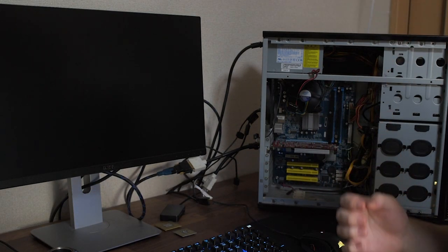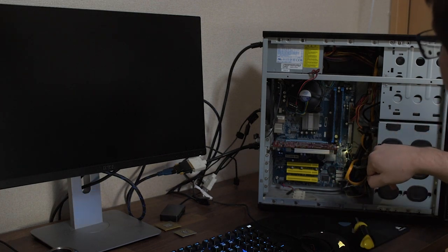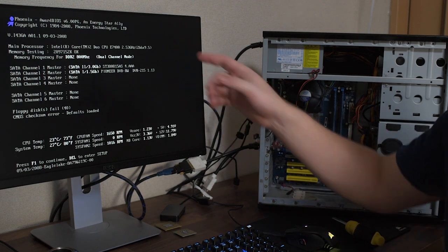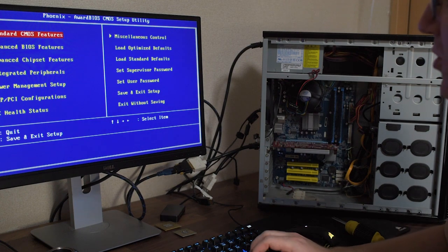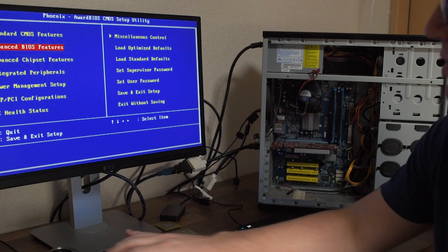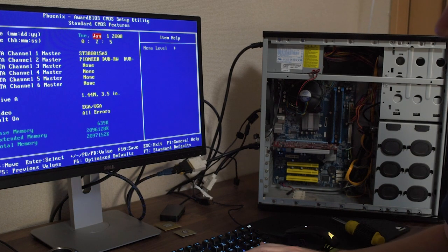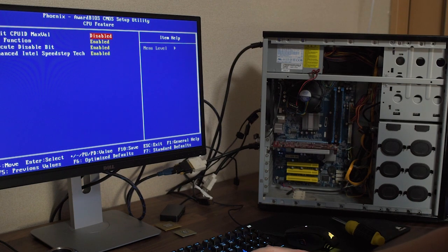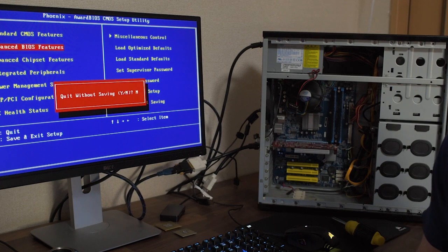That's a tiny bit of a disaster, but I did start it up — the power button on the case seems broken, so I just tripped the on-switch on the motherboard directly, and it works. The CPU that came with the motherboard is functioning. Let's go into the BIOS — it's just super old-school, I love it. I can see the hard drive, the chipset features, and a virus warning. I don't know what all the CPU features are, but it works, so now I'll install Windows and see what games we can run.